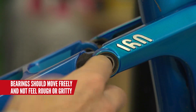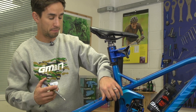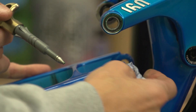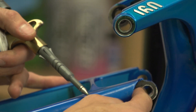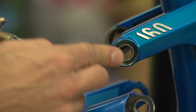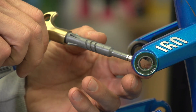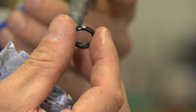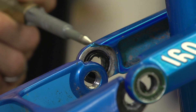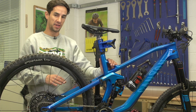It's also a good chance to just check your bearings — spin them with your finger and get a feel for how far off you are from needing to buy and replace a new set. I'm cleaning out the parts of the frame that contact the bearings and the threads. Then I've cleaned this bearing and I'm putting quite a lot of grease onto it — it's just going to seal it a little bit better and stop water getting in. There's a little spacer to keep an eye on so it doesn't fall out, and a bit of grease actually sticks it to the bearing so you can reassemble the back end of your bike a little bit easier. Good practice to do this on all of the bearings on your bike.